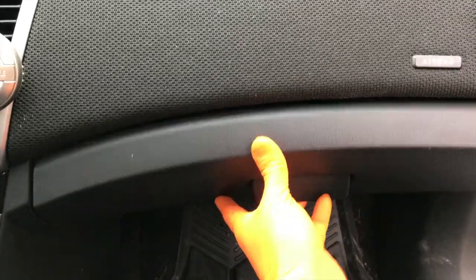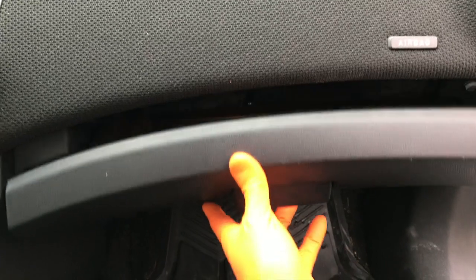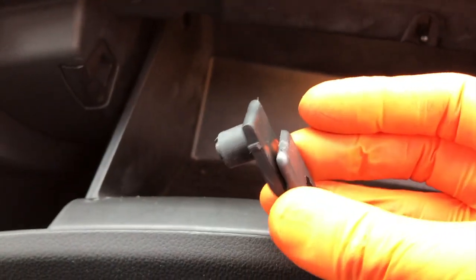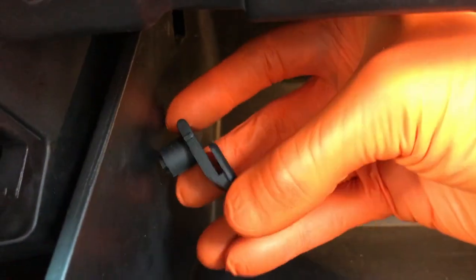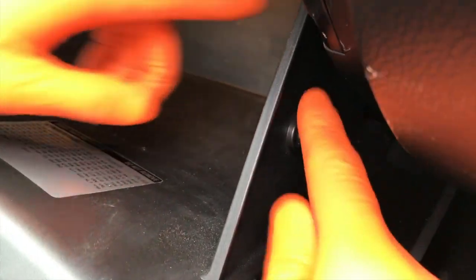Check the convenience of your glove box. From here we'll grab those clips. This is a two-hand step — insert this portion and you'll need to raise your glove box to a point where you can insert it. This little cutout — this portion of the glove box goes right in between those two pieces. Rubber portion in first, push it back into place and secure it. Then we'll do the right side.